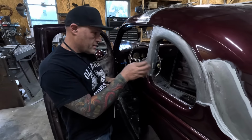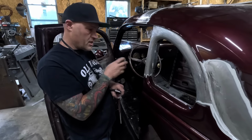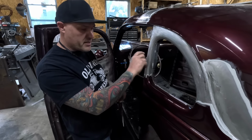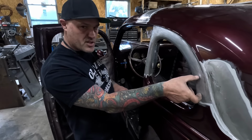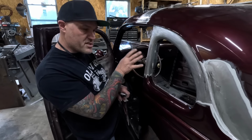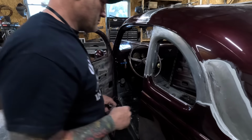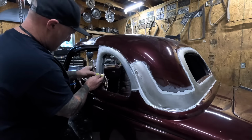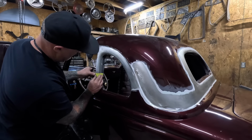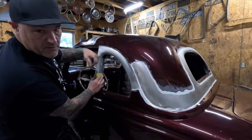So we'll just take and cut it free here, and pull this piece out, and then we'll trim it to fit as we go. We won't actually take a section out of this, because even though we're taking 3 inches out of here, which is at a slant, doesn't necessarily mean it's exactly 3 inches out of here. So we want to definitely wait for this. Same with the doors. A piece of tape measure works good for following that.